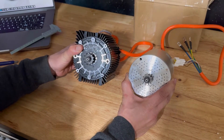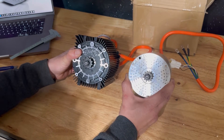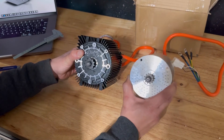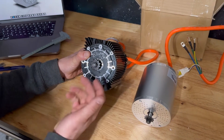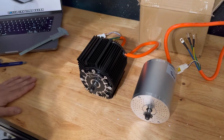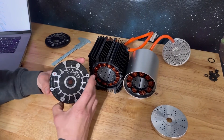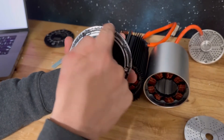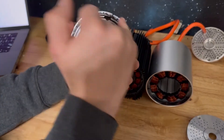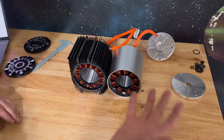You'll notice that the EC4P comes with a T8F sprocket and the MY1020+ comes with a 25H sprocket, because a lot of people will run their stock chain with this. It's highly recommended that with the EC4P you run T8F — we have the ultralight kit on the website. Time to take them apart. Here they are all apart, end caps removed and rotors taken out. First thing I want to look at is the seal one more time — it's got a nice seal there, and the back of the end caps are sealed with sealant, making it watertight. Whereas the MY has none of that, and water can just get straight in.